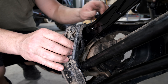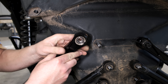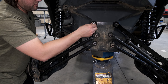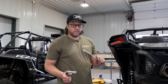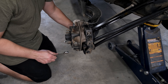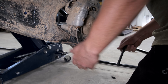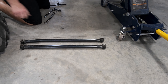Make sure your M is facing the right way. Fish the radius rod back into the trailing arm. Get your bolt handy and feed your bolt through. Put the nut back on finger tight. Make sure the O-ring is in on this side — pop it on, just pushing back. One thing to keep everything from falling apart is take one of your nuts and screw it back on — that way nothing's falling apart.